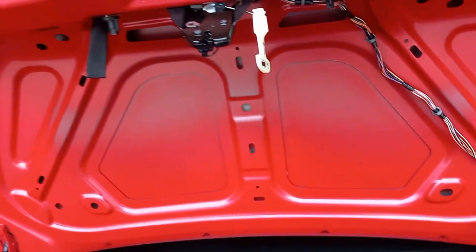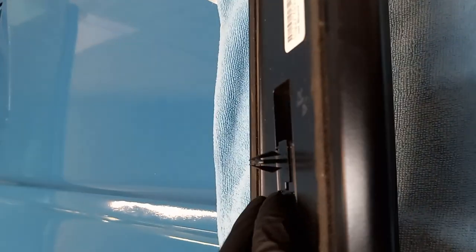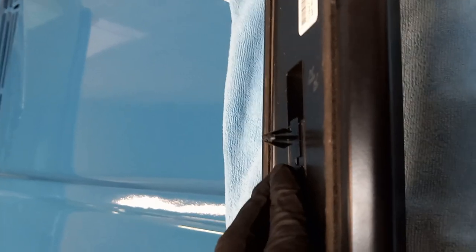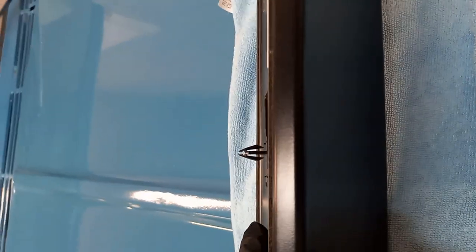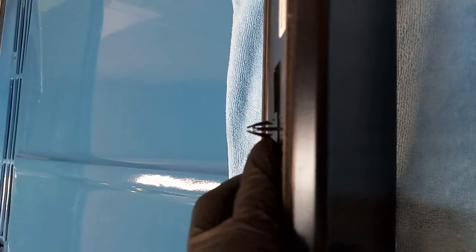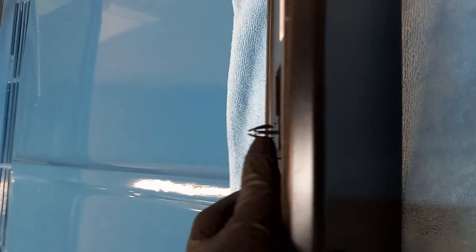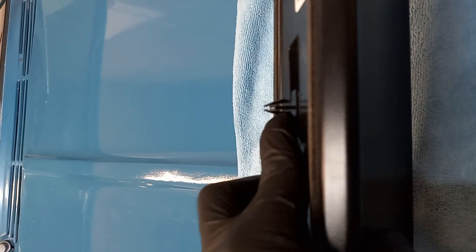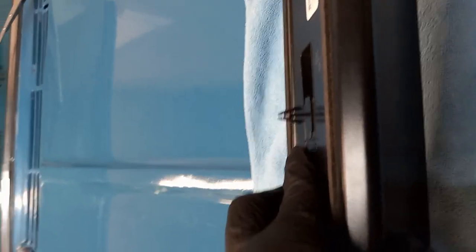This is the level of accessibility to those things. There's the backside of the trunk lid — to get to one of the furthest outside points, it's way over there. Very hard to get to. This is why you'll need something like a screwdriver when this is installed, to get in there and try to get at least one of those wings to compress. There's absolutely no way to film doing this, but if you had some small, really long pliers — those hook getter outers — that might be a lot easier. You'll be pressing in on the sides of these things, just hoping to get one of them to release.